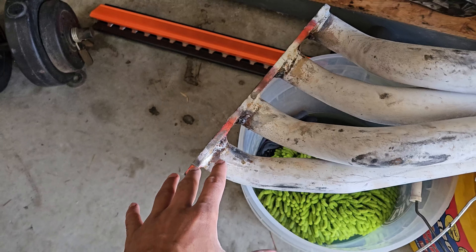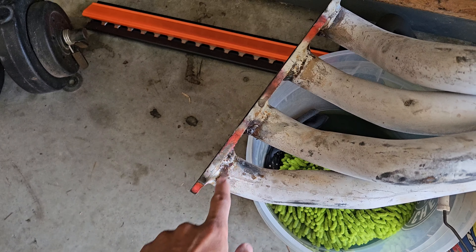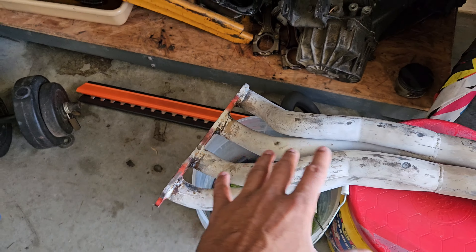We're lifting up the front end of the car right now — that's all we have to do. On the Matrix, we don't have to touch anything up here apart from the exhaust stuff. We're going to take all that off and put on our DC header. Remember, if you buy this one for the Civic, it's definitely not going to fit. You're going to have to buy the 2ZZ flange, cut the old one off, and if you do it yourself, make sure you bolt down the flange and then weld over it so the header doesn't warp. That way you get a nice flat seal over the exhaust — you don't want any exhaust leaks. This is the DC header we're putting on. Trixie had it before we got the PPE, and now we have the DC header back for the Matrix.